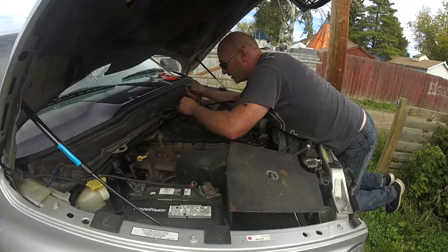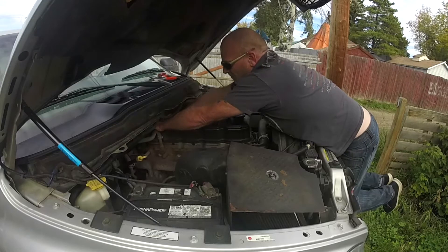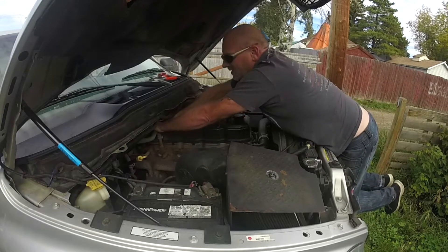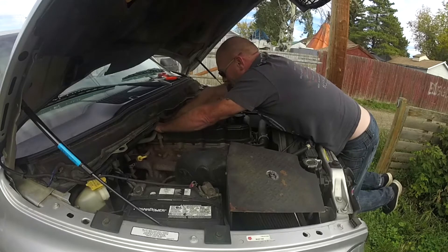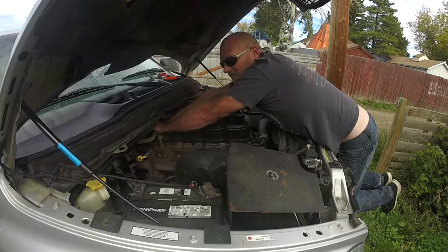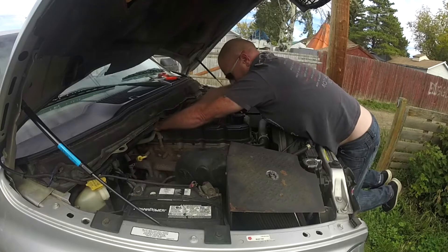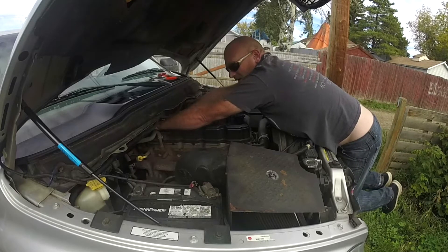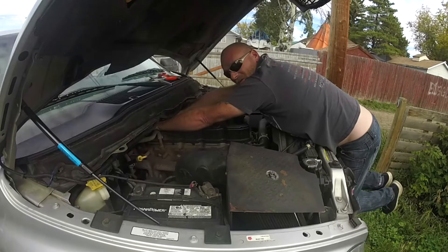This thing didn't have major valve train vibrations or anything, there's no concern for anything else going wrong, but we want it nice and smooth. If you're ever wondering, if your valve cover still has all the factory decals on it, it'll tell you right away where it wants the min-max, basically where it wants your valve lash adjustment. Don't mind my dog in the background - she can see me but since she can't get to me, she's wondering what the hell I'm doing out here.